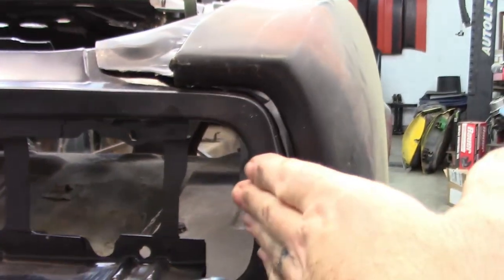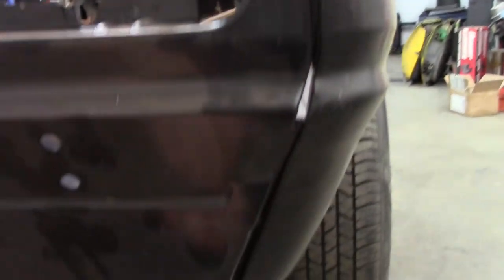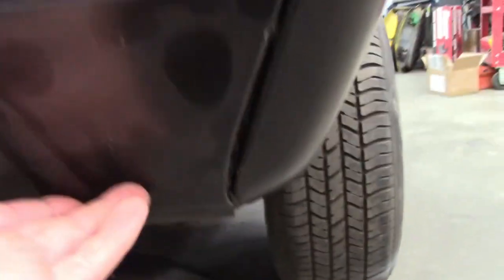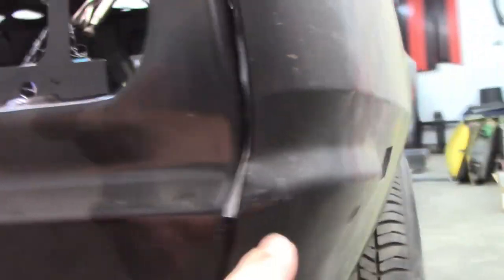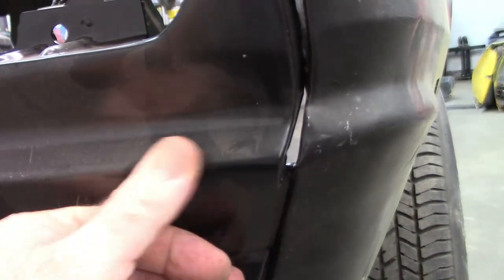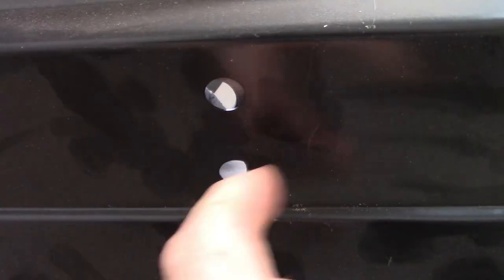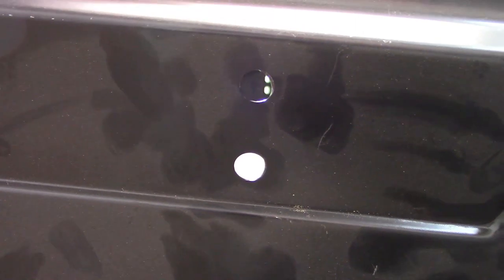The tail panel flange is pretty flat, but on the quarter panel it's angled in — it's going in this direction. So I'm going to have to massage that around to get it to fit, but I don't think that'll be too much of a problem. Down here things are actually pretty close. I like the way this gap is — it lines up, the body line is pretty close. I did see that the holes where the bumper bolts on look like they're off just slightly, but if I push this over, those things are dead on. So I'm really happy with those.